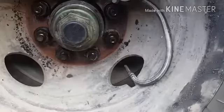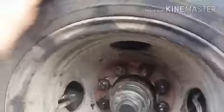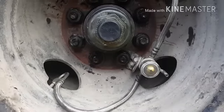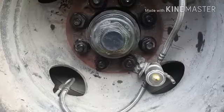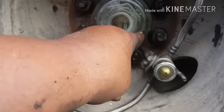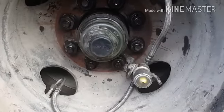Fellas, I got everything back together. Cap's on, not leaking. What I'm doing is turning it — I put some hub oil in it and I'm just slowly turning it, letting that oil seep to the back on them bearings. Then I'm going to let it sit for a while while I check all the other hubs. The boy moving slow, so I might as well complete all my maintenance. Let it sit, recheck it, top it back off. You want your line — it's got a little line right here. You don't want it right at the top. I put mine a little bit under the top. You can see the oil settling in, getting all the way to the back. You don't want to overfill it either — too much pressure on the bearing.